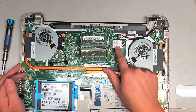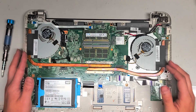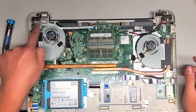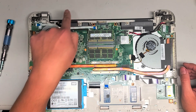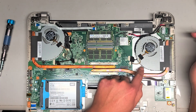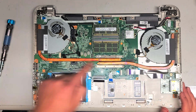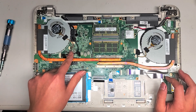You've got the wireless card. A lot of these things I'm not going to show how to take out — if you want to see how to take out these types of connectors, you can watch my other videos. You've got a board for the power button, which is a removable piece. You've got the LCD LVDS connector — if you're going to mess with the screen connector, make sure you remove the battery and press and hold the power button for about 10 to 15 seconds. You've got the fans here — just take out two screws and pull the connector out. They put two heat pipes and two fans for the CPU, so this laptop should remain pretty cool.